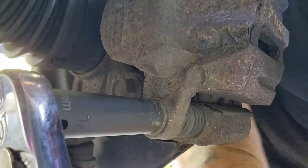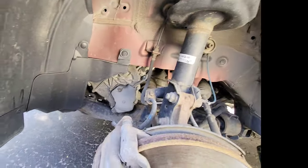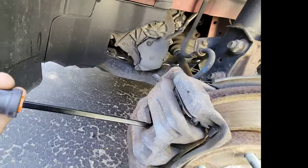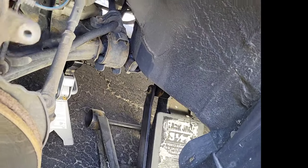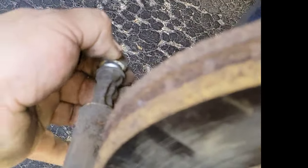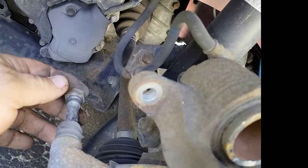Let's get on here and do the bottom one as well. Most of you guys know how to change brakes, just showing you how it is as a mobile mechanic. Maybe we need to compress this a little bit — grab a screwdriver, see if we can get it stuck in there. That way you can just compress it in a little bit so we can actually take it off. There we go. These pads have a decent little life left — I know they look 50%. Pop them out, see these clips — pop these all the way out, take both out, wipe them off, put new brake grease on them and slide them back in.